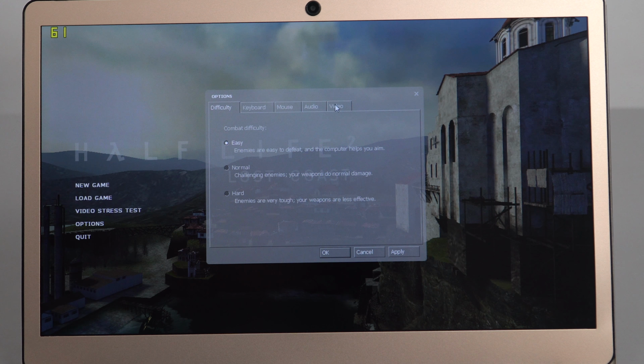So I'm going to try now with the wattage, the power limit set to 15. So that's just given us a couple more frames per second, so not really too much of an improvement there. Now the thermals, I just had a look, it got up to 67 degrees, so only 1 degree more. Of course, this is only just the benchmark, so if you intend to game for hours on end, then expect those temperatures to keep rising and climbing, and you can always add a thermal pad too between the copper heatsink and the rear body of this.